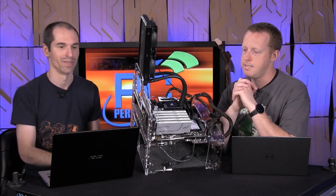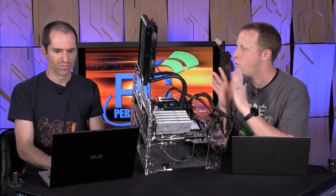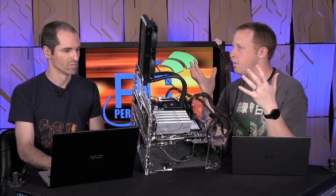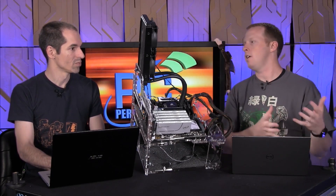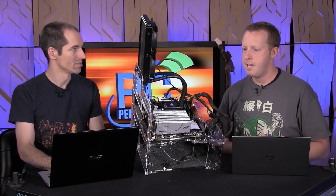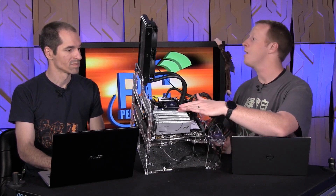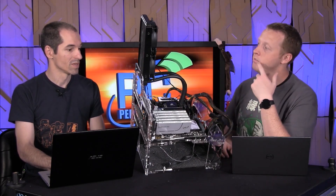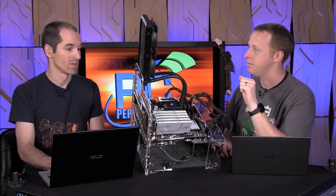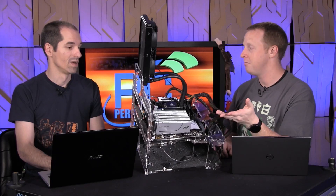How much are these 400GB drives? Around $420–$450 each, so four of them is $1,600 to $1,800. That's a lot of money, but it's not crazy — it's 1.6 terabytes of storage and you're getting an insane amount of speed. If you had four of them, you could do the four bottom slots and still have a regular graphics card up top. You could do four 1.2TB models too, though you'd pay a lot more. But you wouldn't be able to boot off the RAID array, which is a drawback.